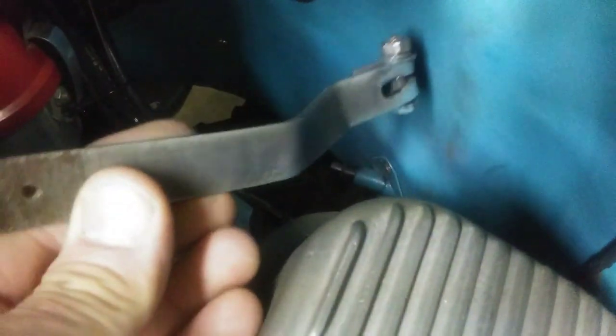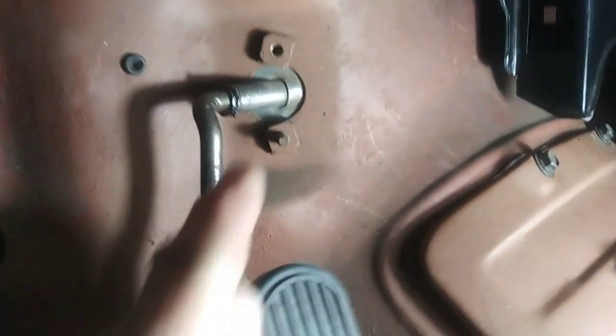Alright, well, I got the rod off. Then I got this linkage bar off of there. It's just got that one bolt there, 7/16 head wrench. Comes off of there, wiggles off. I got one of the top bolts out of there. Don't think they're the same pitch thread as the ones that came with the kit. So I got that one out.